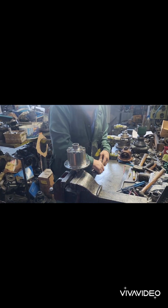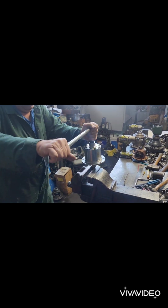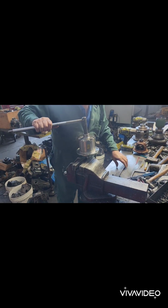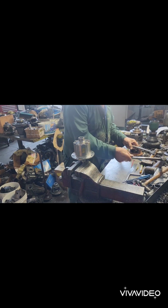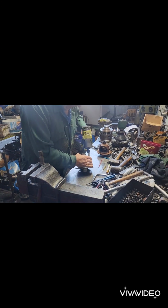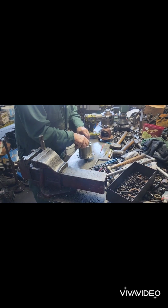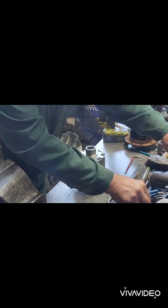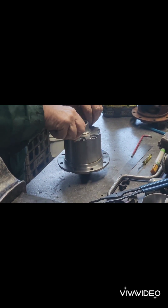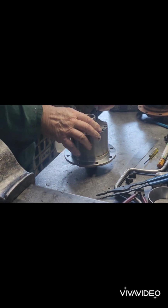See that out? It's a bit tight, because I put several shims in. See, it's firm. Well, you don't really want it like that. It's a bit too tight. You've got to put the bell washers in there. So there's a 5 thou shim in here, which I can take out to prove that that's all it needs for the final amount of shims.